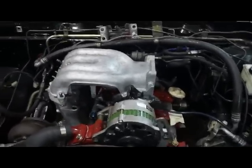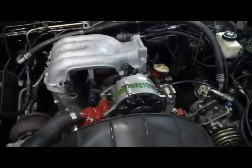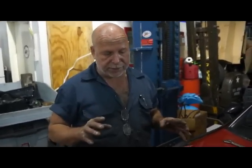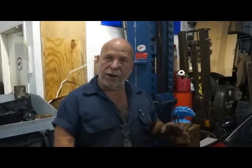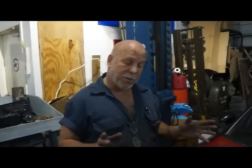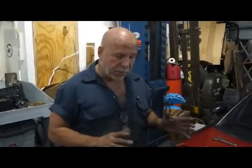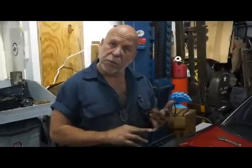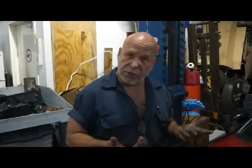A Frankenstein would be... Well, you said you didn't like the third gen rotors before. Right, I was. Exactly. But what I would consider a Frankenstein, and believe me, I've done it, not by will, is to take, let's say, a third gen rotor and a six port rotor. Just throwing together stuff, that would be really careless. You want it to be a little careless and careful and still be a Frankenstein. A Cosmo rotor versus a third gen rotor. They pretty much weigh the same, look the same, but the combustion chamber is totally different. That I would consider a Frankenstein.